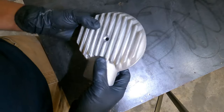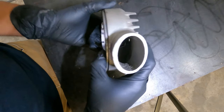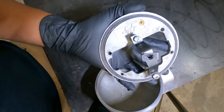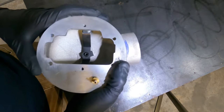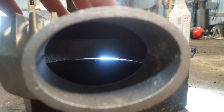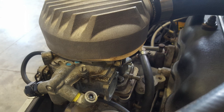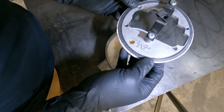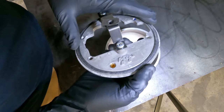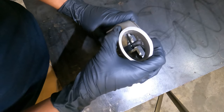To connect the turbo to the carburetor, you're going to need what's known as a carb hat. This is the only one I know of that fits a Weber DG Series carb. The casting says K&N, but I don't think it's a real K&N product because the quality's not great. The bottom had to be sanded to fit, the top half didn't seal either, and the paper gaskets included wouldn't hold boost — they kept blowing out. Eventually, I machined the base to take a standard Felpro 2104 carb gasket for a 4-barrel Holley — a composite steel gasket rated for boost — and it worked fantastic. The weird oval-shaped inlet fits a standard 2.5-inch silicone coupler just fine.